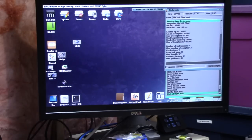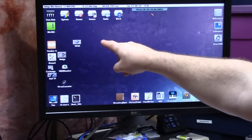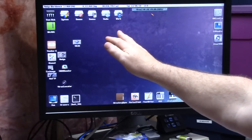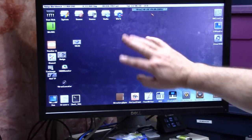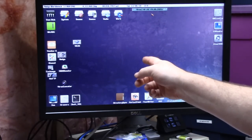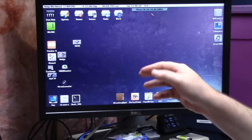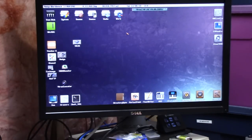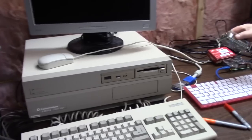With the video I did on this, and I know I'm talking a lot and I am sorry, the Pi-Mega Lockdown Edition, if you build this, go into System Programs and fire up Virusz and let it run. There are about 400 of the Happy New Year 96 viruses floating around on here. Do not do anything without Virusz running. There is a new bootblock update on the webpage of the people who make Virusz. They have some new stuff for that new virus that came out in 2020 because I guess during lockdown everybody got bored and decided to screw with the Amigas. But that's about it. That is my video on the Vampire Amiga 2000 versus, whoops, almost knocked the fan off here, versus the 3B Plus and the Model B 4GB Pi 4.